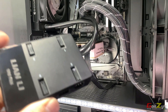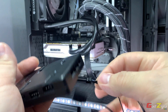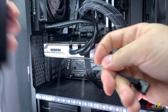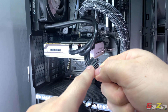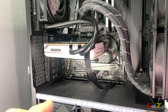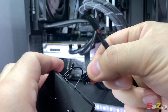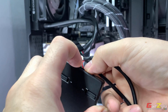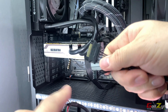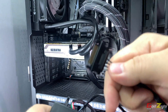Next, I'll connect the unit with the cables provided. I'll first connect one end to the unit. This cable allows you to use the motherboard to control both the ARGB and the fan. This connector is for ARGB, and this one is for the PWM, which connects to the motherboard fan header. Next is the USB cable — one end connects to the unit, and the other end is plugged to the motherboard. Last but not least, the SATA cable: one end connects to the unit, and the other goes to the PSU.